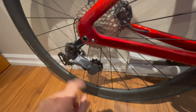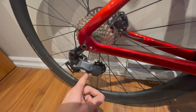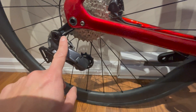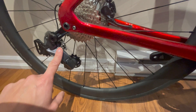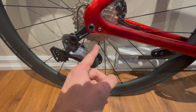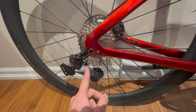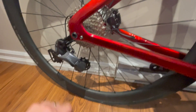The rear derailleur is on — that's the new Ultegra R8150, Di2. I did swap the derailleur hanger; I wanted to try the direct mount derailleur hanger. I'm still not totally clear on the advantages, but apparently with direct mount the derailleur sits farther back because you remove the b-link, so it's easier to remove the wheel. It might make a difference for the pros but for most people it doesn't, though I want to try new stuff with this bike.